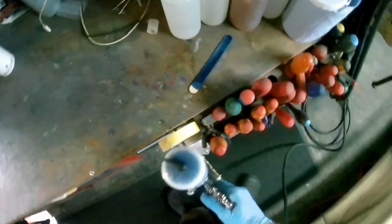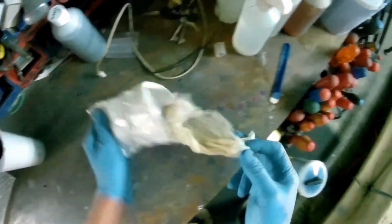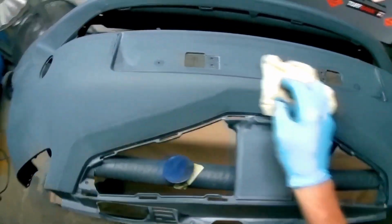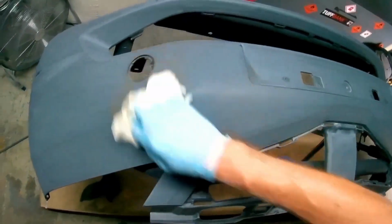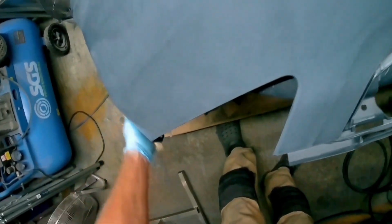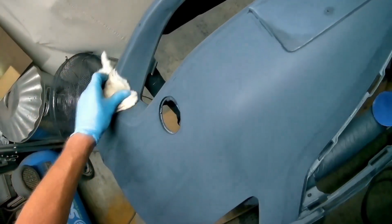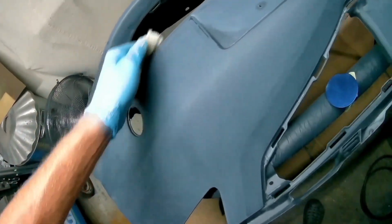This takes about 600 millilitres of base coat, and it's on a primer base, so it's a good base. So we can put a good amount of material on from the start, and this gun lends itself nicely to that because of its wet pattern. The coverage is really good, so you can just get on with it and do the job.